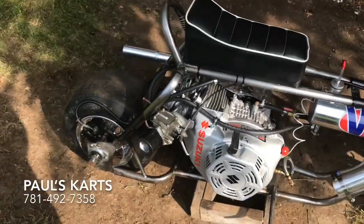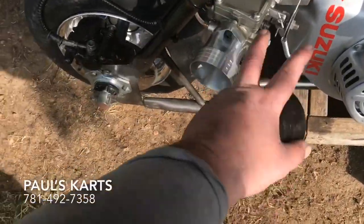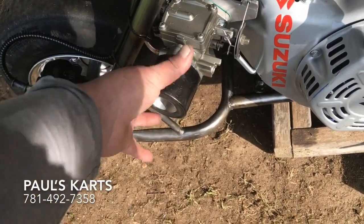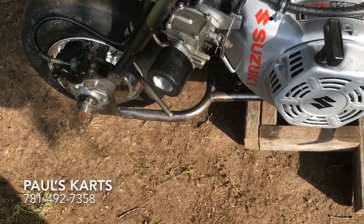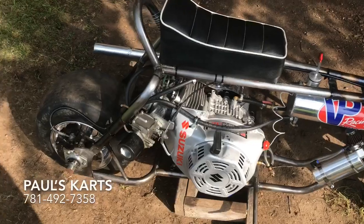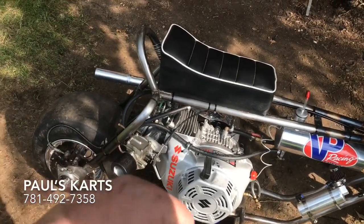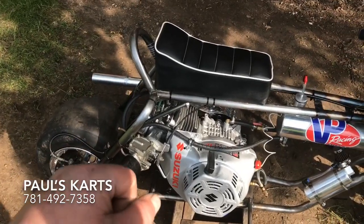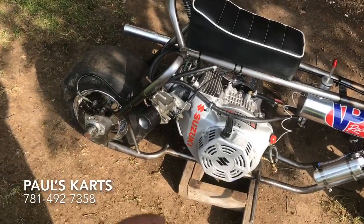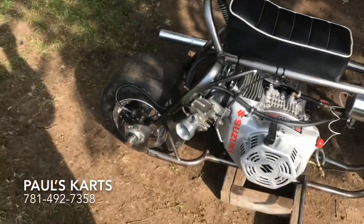So I was actually messing with my fuel signal. I had made this — basically a thin filter I put on first, then put this over it so there would be a thin filter in here. This wouldn't be wide open. Then I'd take a clamp and put it around here and this would be one big nice unit. As I did this, I started real small with the hole, and I'll tell you — when I started with that small hole, instantly the throttle response was quick and spontaneous. It just felt like a much more easy-to-ride bike. It was just predictable: you hit the gas and it was just predictable. As I went up in bore and bore and bore, it got a little bit more unpredictable, which leads us back to where we were in the beginning.